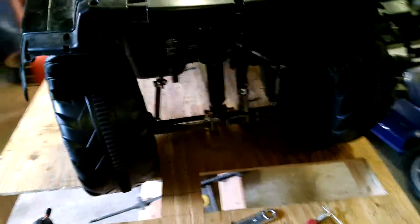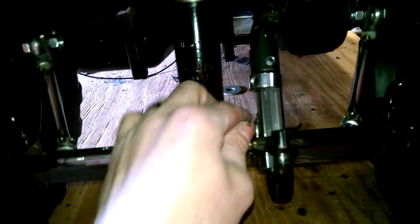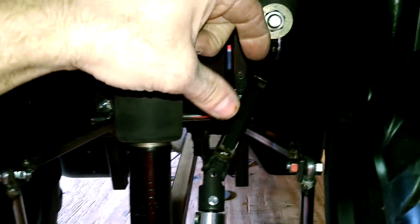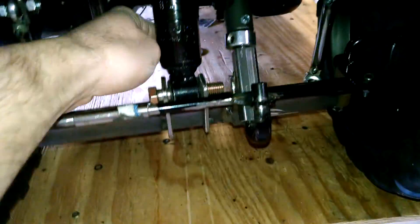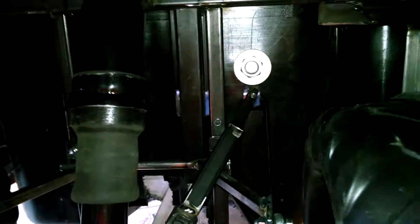Update on Project Hellram — got the steering and the anti-sway bar all figured out. Because this has five and a half inches of lift on the air ride, we had to make a telescoping shaft: a three-quarter inch square tube inside of a one inch tube — it's like a spline shaft. And because we use the mono link, we had to add an anti-sway bar so it doesn't rock side to side. As it goes down, you'll see this shaft will actually slide.